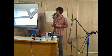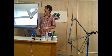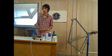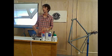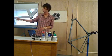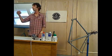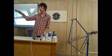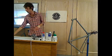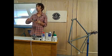Can you describe the sequence for this? Yeah, definitely. That would be white first, because I always do the outline first, even if it's darker, unfortunately. Darker first and then lighter later. So that one works out pretty well because it's just white first. And then I would put down that vinyl in this shape for the text. Then I would put the bronze metallic brown on the inside. And that's a good question, because I would put an intermediate mask which goes in between this outline. So I have another mask that is just a solid text here.